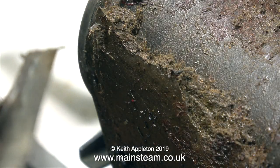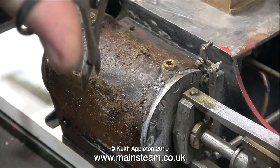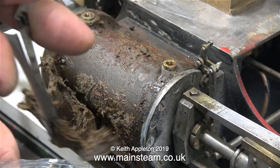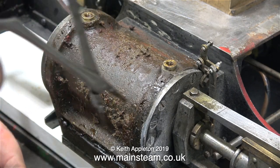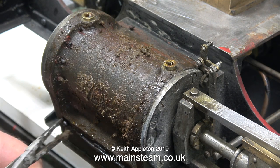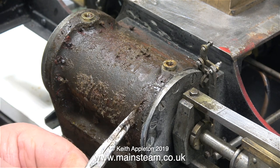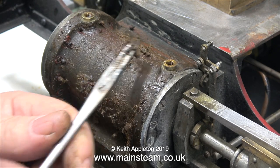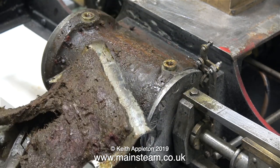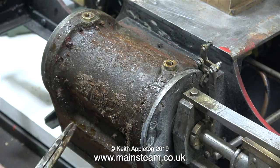What have we here? I wonder what this stuff is — is it asbestos, or is it just some sort of wooden fibre board? Either way, I'm going to remove it. It's probably asbestos, so I'm taking it all off very carefully and putting it in a plastic bag. Health and safety warning: asbestos is dangerous. If you're doing jobs like this, make sure the asbestos is very wet so you do not generate any dust that you're likely to breathe in. I also recommend wearing a breathing mask. It's not much of a problem here because it's very, very oily — completely soaked in oil. I'm still not touching it though, because it's horrible stuff.